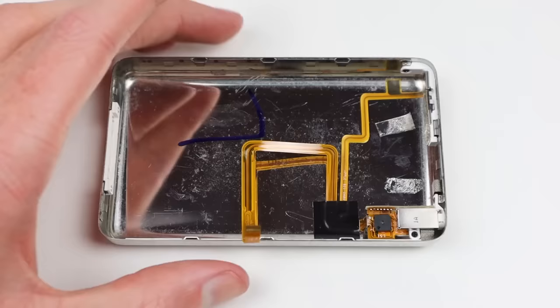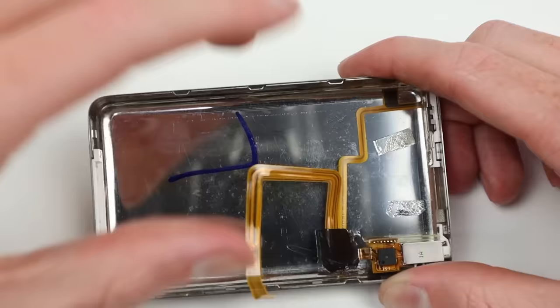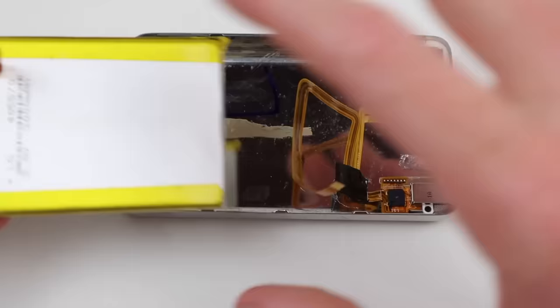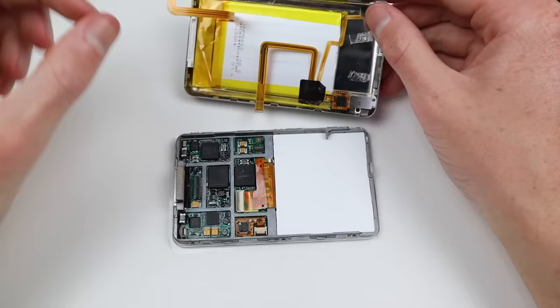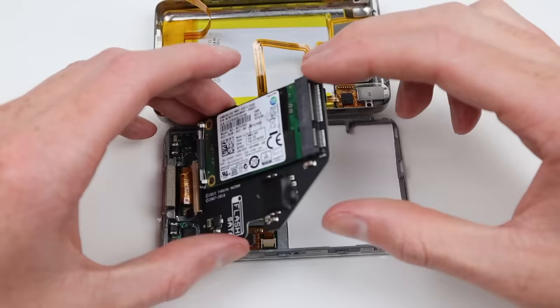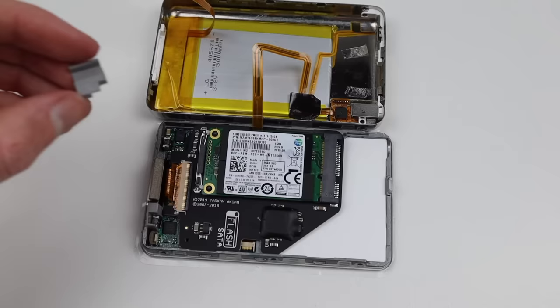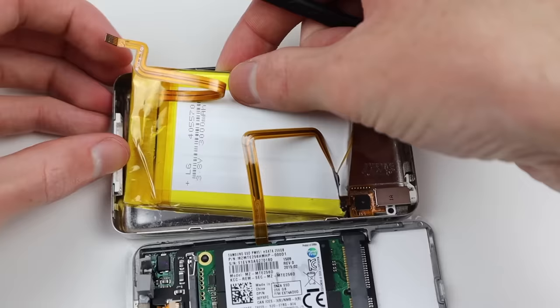After roughly installing the new faceplate, I made sure no specks of dirt or dust were underneath the display, then began reassembling by installing the six screws around the side and plugging in the LCD panel. Now I need to figure out what to do with the huge 3000mAh battery. The old battery was at the top of the device, but the new one is absolutely huge and doesn't fit in that spot. I first installed it at the bottom, made sure the linking cable was plugged in, and reinstalled the flash adapter with the SSD. However, I noticed the battery cable was on the wrong side and the dock connector was interfering with the top portion of the battery.